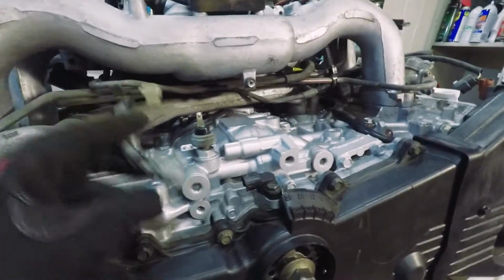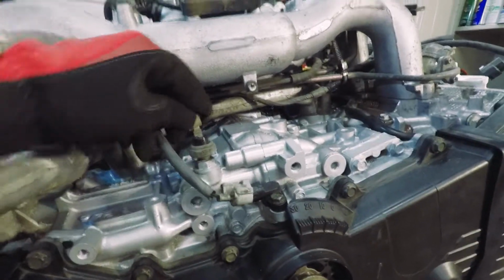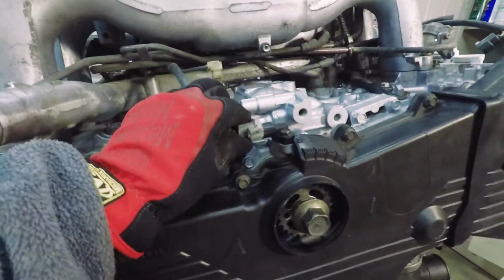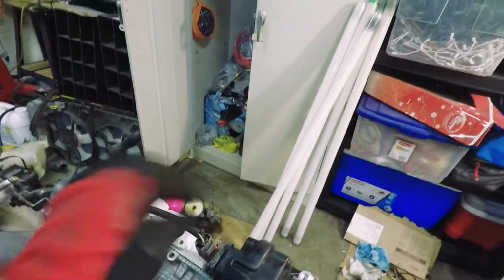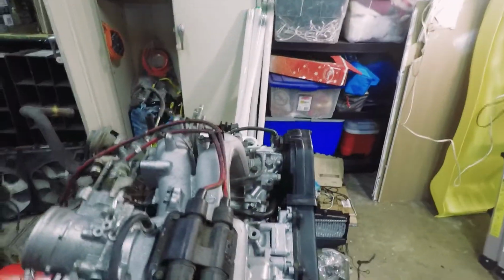On the front side of the harness coming off of the intake manifold, you'll have a few clips, a splayed connector for your oil pressure sensor, crank angle sensor, and then a cam angle sensor here. Make sure you get all those plugged in. Double check around that nothing else is unplugged, and move on to the next step.